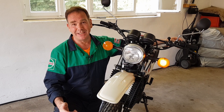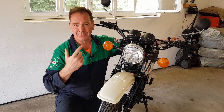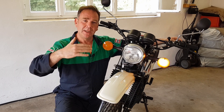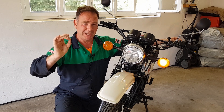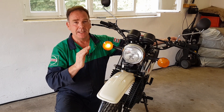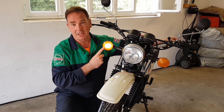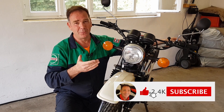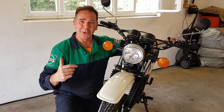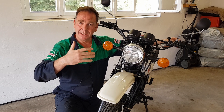We've finished changing the module and fitted the new LED combined relay unit, and things are much better. If we turn the ignition on, we now have indicators that work correctly — they don't flash fast, they flash at the correct rate. The bike's been running, and it now copes because this relay module handles the DC voltage fluctuation and gives us a stable indicator. Look how bright they are — it's a really quite a difference from the six-volt setup.